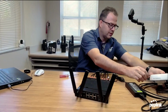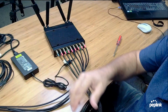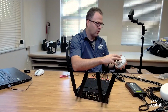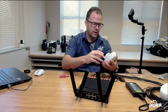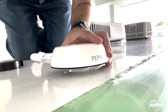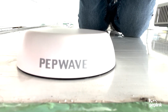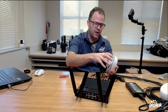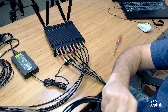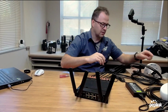So I'm just going to put my antennas right here. I apologize, it's going to get a little messy. These antennas are designed to go on a vehicle. And if you haven't seen these antennas, they come with a 3M tape as well as a nice little screw-on. So this makes it really easy to seal this down. Whenever I install these on a vehicle, I drill the hole, put the 3M tape, and then I wipe down with isopropyl alcohol. It really sucks up all the water, and you can almost touch the surface of the vehicle and feel that it's kind of tacky when you wipe it down with the alcohol. Then put the 3M tape down, then stick this down. It truly creates an amazing installation process, saves a lot of time from glue or something else having to dry. And if you're really worried about any sort of leaking, just throw a silicone bead around the edge of it.